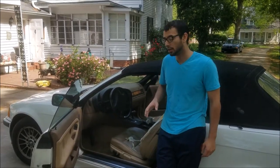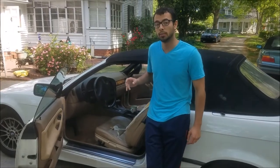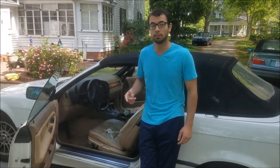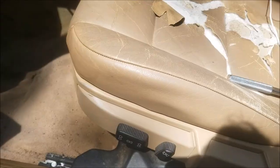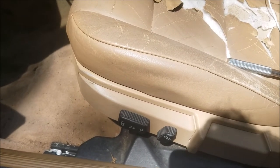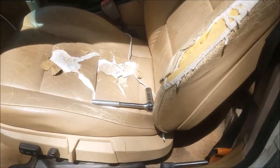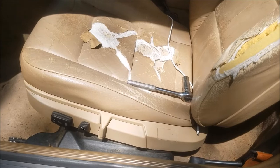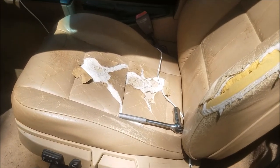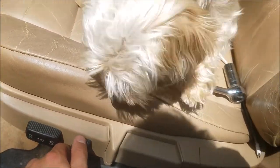This video is going to be my recline feature repair, which more than likely is going to be a gear in the gearbox. They have two plastic gears inside — one of them probably went bad. Inside the gearboxes they have these plastic gears and they don't frequently go bad, but when your seat stops working it's frequently the plastic gear. What you'll see is it's broken into like a hundred pieces, shattered into little bits, and it just does this over time.